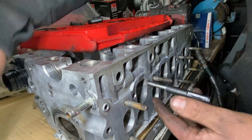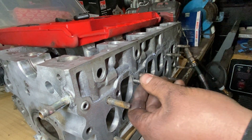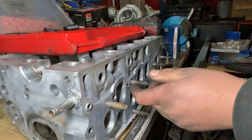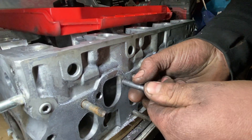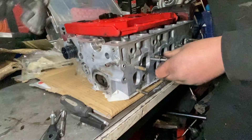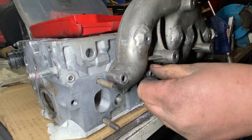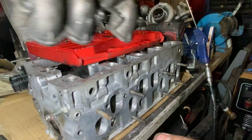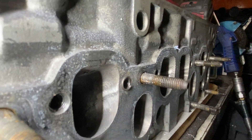Just blow it off. If the tang doesn't come out, just blow it out. Now we need to try to see if the bolts fit — and it does! Let me try with the manifold in place just to see. Yeah, it does work. I think I'm just going to have to cut a little bit there because the helicoil didn't go all the way through — it's quite big. So I'll just cut this bit off here, and job done. Thanks for watching, guys.